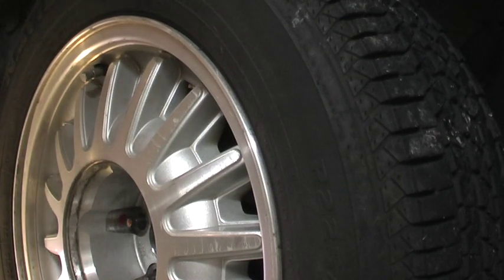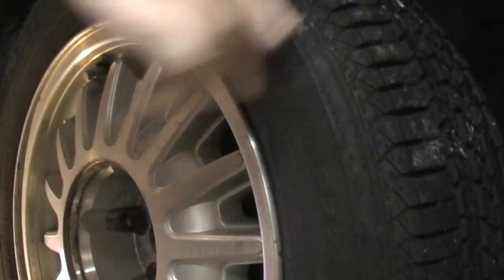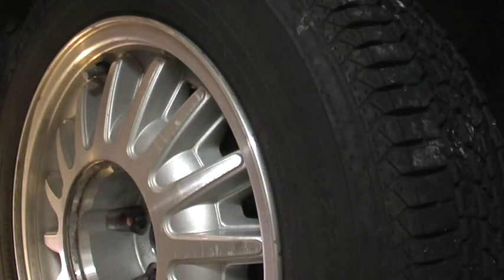and follow along. What I did was I put new brake shoes on it, and I didn't think I needed to change the rotors, and now I can feel in the pedal that the rotors should have been changed. So I only wore the brakes out probably very slightly over a week, and we're going to go in and we're going to change it.